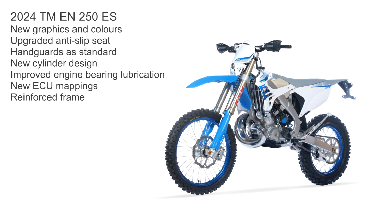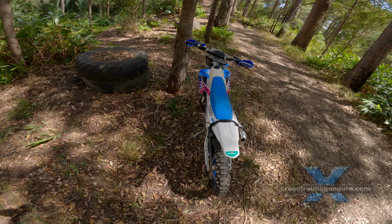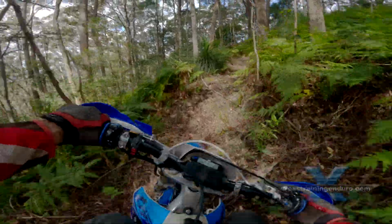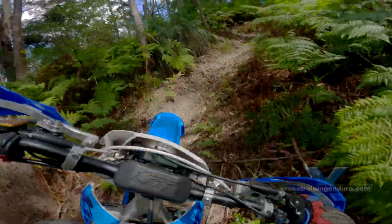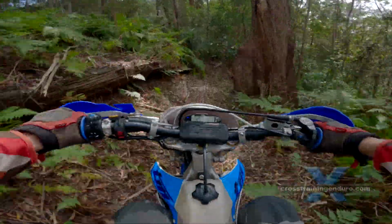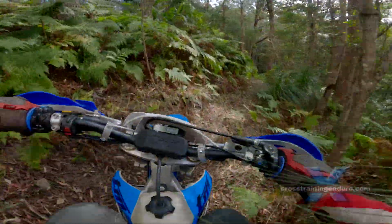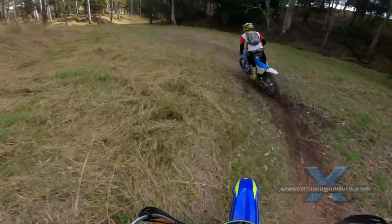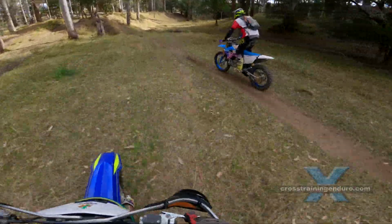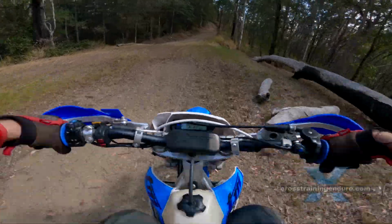I think it's the racing nature of the TM which may be the deciding factor for many riders. Those of us into hard enduro simply didn't like the power delivery. We were stalling or bogging the engine in slower terrain due to the lack of grunt. Then we were caught unawares each time that power band kicked in. In fact, the EN250 reminded us of old school two-strokes.